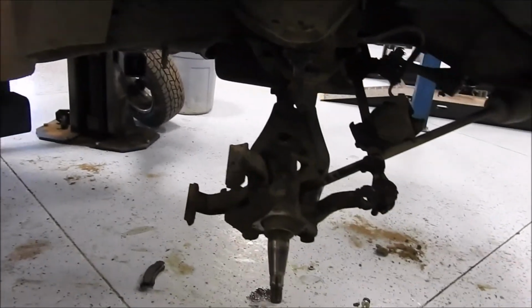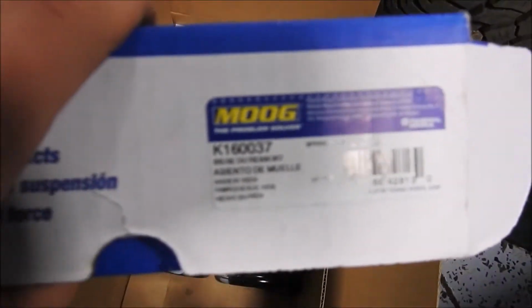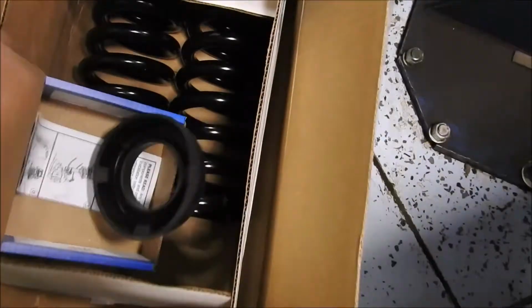So we're going to throw it back together with our one shock isolator. I think I'm saying that right, isolator? Something of the sorts. But yeah. So I will put the Moog part number for these springs down in the description. This is the Moog part number. It's a K160037 for the isolators, and I only got one of those, so I'm going to put this side on.